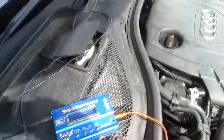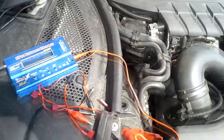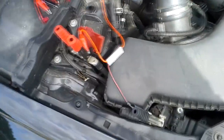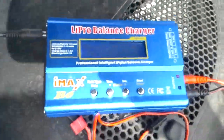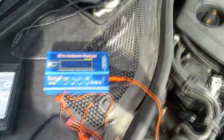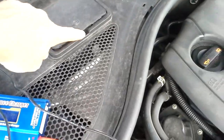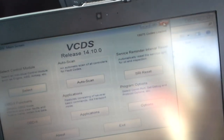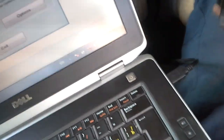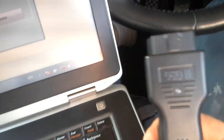And the main thing: we have a battery charger. You need to charge the battery at the same time, so I'm connected to the connectors which are used for jump-starting, basically charging the battery — which is needed during the process of replacing the parts. And of course don't forget to open the cap of the brake fluid. So VCDS software — this is the one I use to release the electronic handbrake. You need such a cable; it's an OBD2 protocol, you just buy it on eBay. One end is USB.